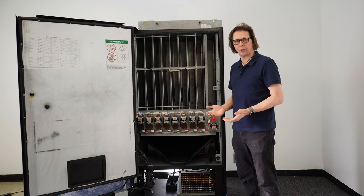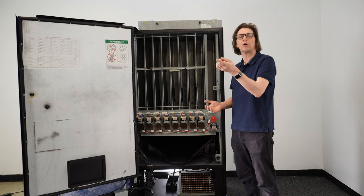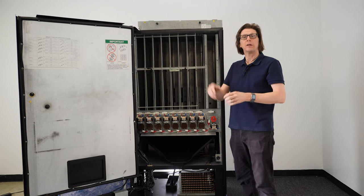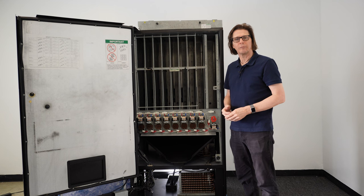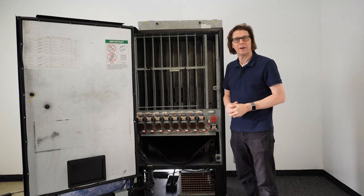This is completing the circuit. The voltage coming into the common is exiting out the normally closed pin, going back to the control board. The control board sees that the circuit is completed — that means there's product in the column. That's how the computer board can tell if there's potentially product in there.